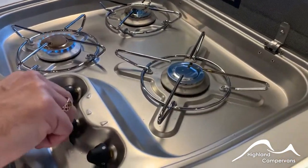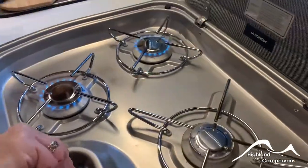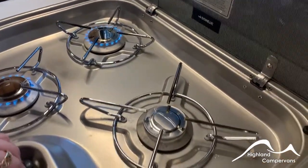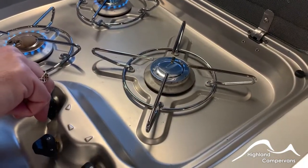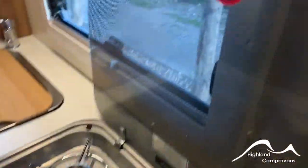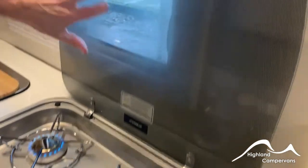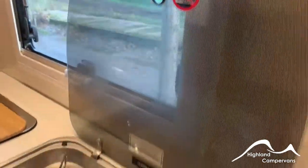With the gas system lit it's important to note that there's no isolator on these glass lids, so make sure that all of the burners are switched off — because if you try and bring the lid down over a lit burner it won't cut out, it will continue to burn and it will cause the glass to shatter and explode.